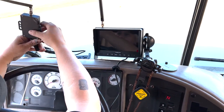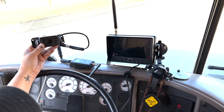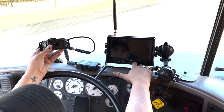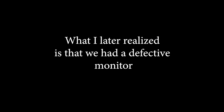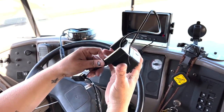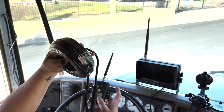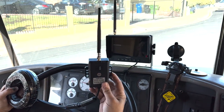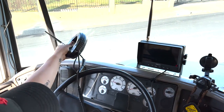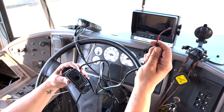So there's the camera. Let's turn it on — I'm just checking I'm doing it right. The splitter connects to this guy that's gonna go at the front of the coach. This is the wireless transmitter that helps everything talk to each other and connect. This is gonna go above the bus and come all the way to the front, on the outside of the bus. Once we connect this, the 12-volt line is gonna come into the bus to give power to the camera.